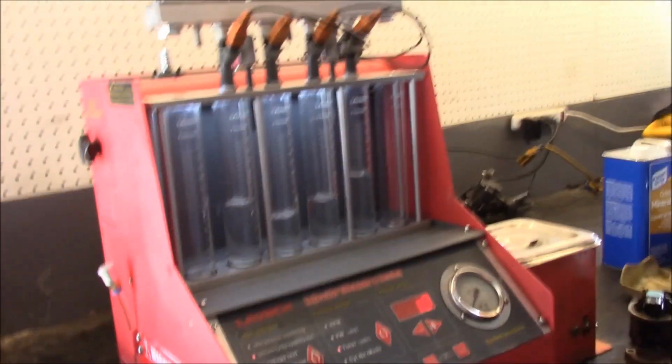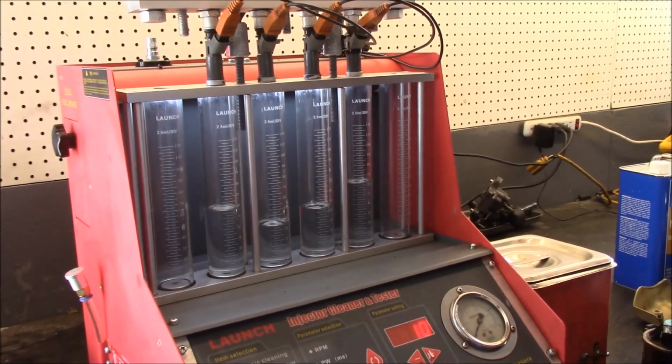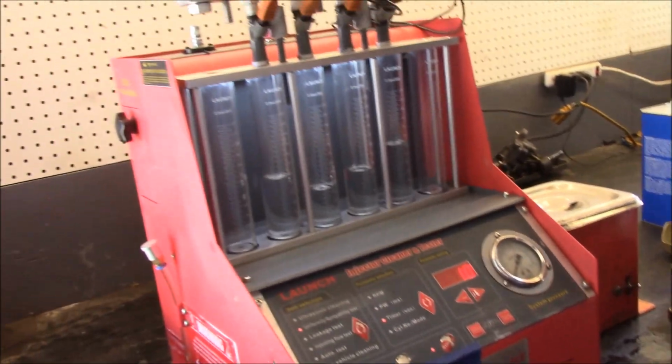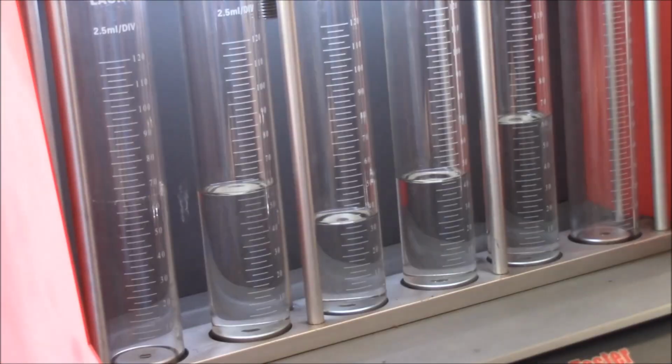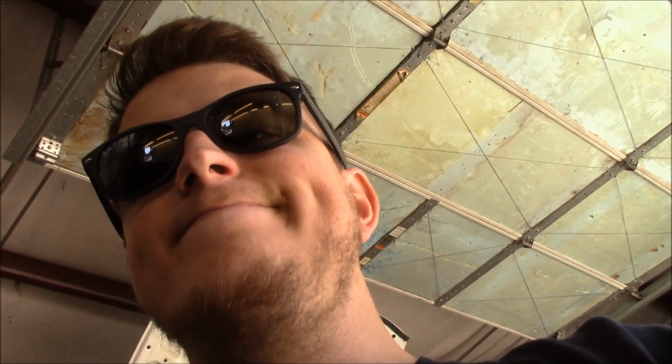You'd be leaning out two cylinders. That's the point, though. It idled on two cylinders, so it's only running on two cylinders. Dang, look how uneven that is. That's bad. Brand new injectors. That's why you can't buy those Chinese injectors. Then we can do another test. I'm just kidding. What injectors are those? Paradise Racing 2200s. Not talking bad about anybody's injectors. They just had a problem with them, and they're brand new. These haven't even been run at all? They've been in there for some idle, and we never did get them on the dyno because we had an ECU issue. We never did any tuning with them.